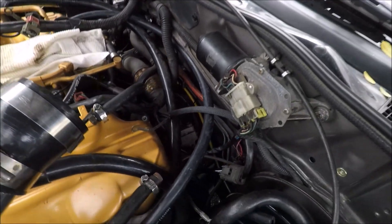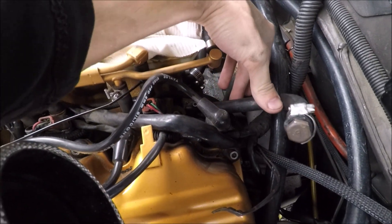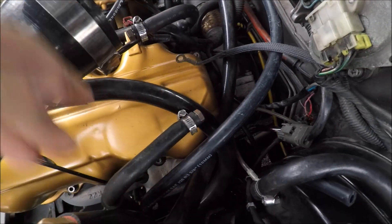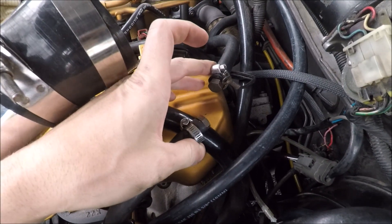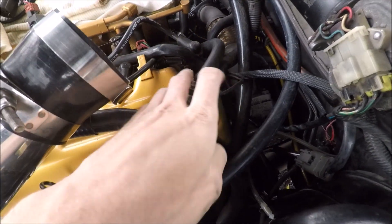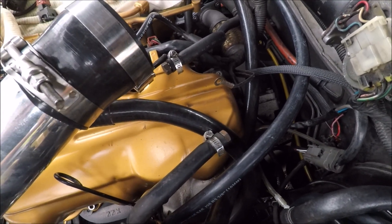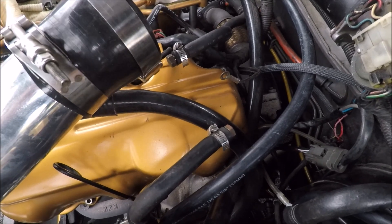We have a line coming off the back of the lower intake manifold and a line coming off the turbo — I just have bolts in them so they don't leak with the plenum off. The whole point of this mod is to connect these two together, because both ends originally go to the throttle body. Connecting them bypasses it. If you live in a hot climate or don't drive in winter, it's just not really needed to run coolant through the throttle body.